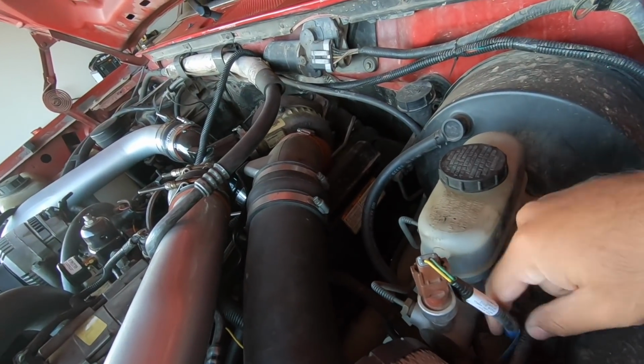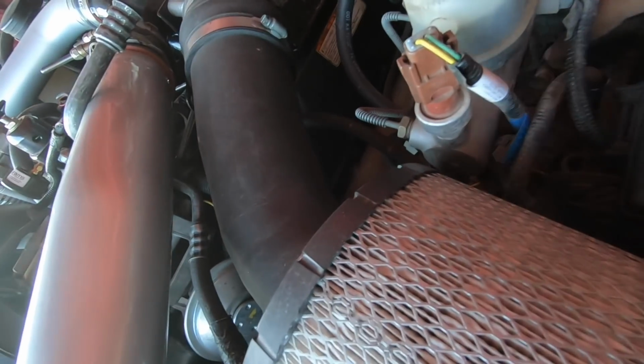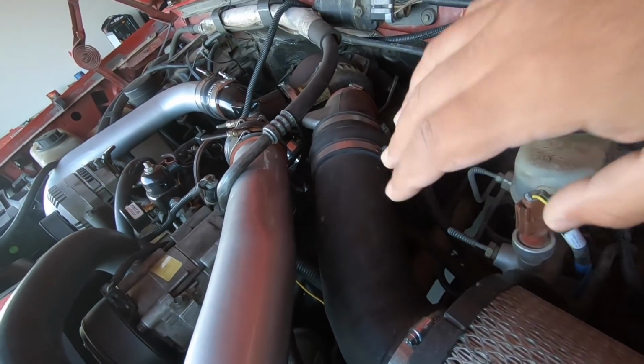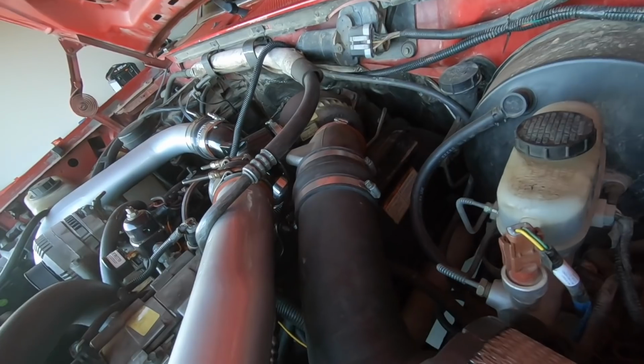And as you can see, it's the brown top, blue tag, and it's got a couple fuses on it. Now the one that I got has no fuses. It's just the switch sensor and the little pigtail. So hopefully they got it right, because there are no fuses on it anymore. It should be a fairly simple process. You just have to take this one out, which I believe is a 9/16 wrench, put the new one on with the 7/8 wrench, plug it in, and we should be good to go.